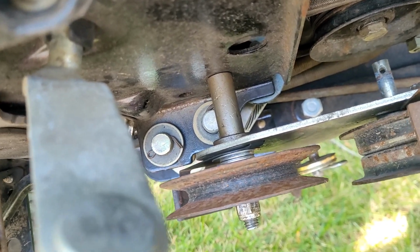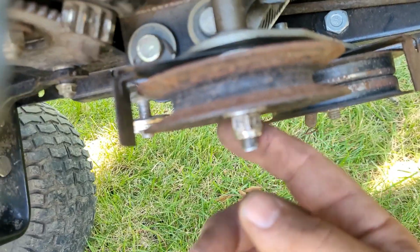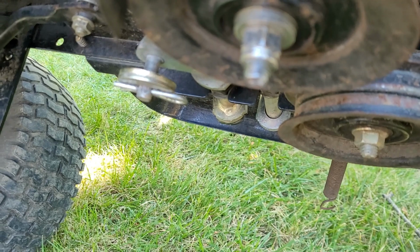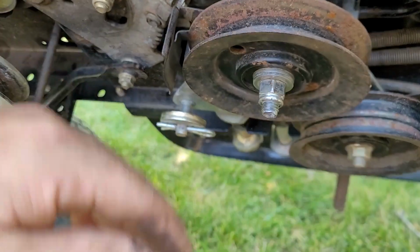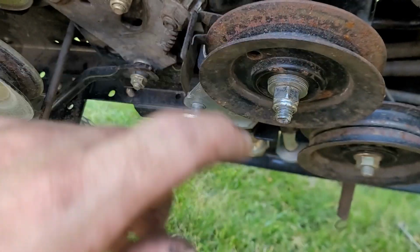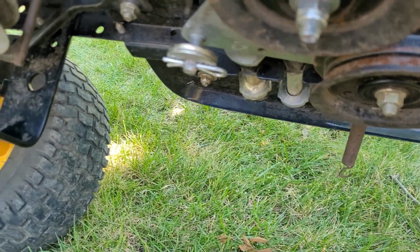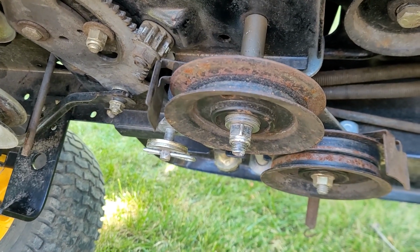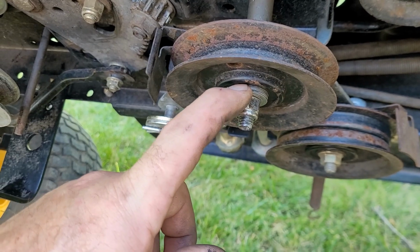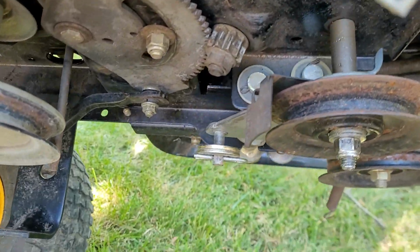It's got a little play, which is normal, but we got the proper amount of washers and spacers on everything. I put their nylock nut on there. Again, it's not really proper, but with 2 washers, I think before they were crushing in to the bearings and slowing them down. So if you have 2, it doesn't really crush. It doesn't really cone shape up in there, if that makes any sense. And now that pulley rolls properly like it should. It's not jamming and creating a bunch of heat from the friction of the washer rubbing against the bearing. When the washers are standing still, this needs to be able to move. So I think we're good.